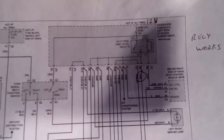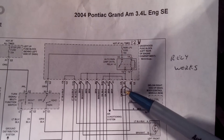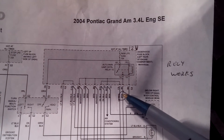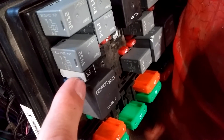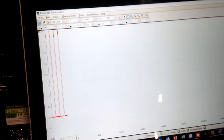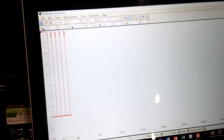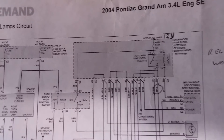Back to the diagram — the amp clamp is around the brown wire, and so far they've seen nothing on the amp clamp. But this time they'll go ahead and turn the circuit on. You can hear the circuit breaker clicking — it's a 15 amp circuit breaker to replace the 15 amp fuse. And if we come over to the screen, every time that circuit breaker clicks on, it's going up to 15 amps and then shutting off again. That was how we quickly narrowed down the short to find out which circuit it was in.